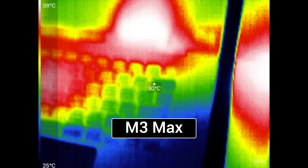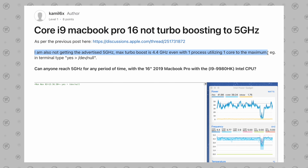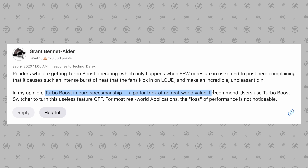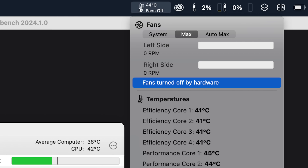What I discovered is it's not really the high power mode helping — it's actually the temperature of the whole machine and chassis. There's some kind of temperature limit where it won't give you the full 4.05 GHz unless the whole system is cool. In this way, these new Apple M3 chips are acting like Intel chips where maximum advertised clock speed is only reached if the chip is very cool. I also noticed that TG Fan Pro showed 'fans turned off by hardware' — the system was overriding my fan control settings.